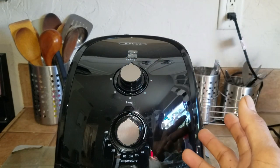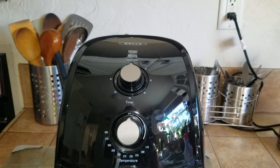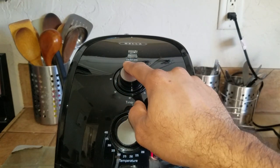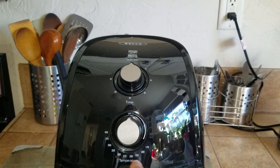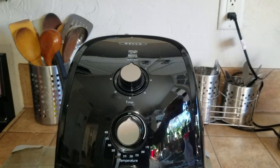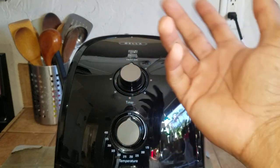The downside is that once the dish is done, or if you overestimated the time and the dish is done, you have to wait for the timer to click off. The easy bypass is to rotate the heat temperature dial to off — that way the coil is off. Disconnect it from power at that point, and once that's done the timer will just ding.